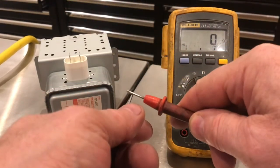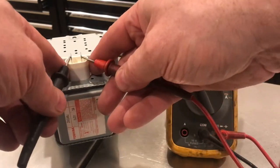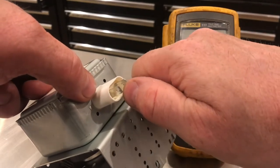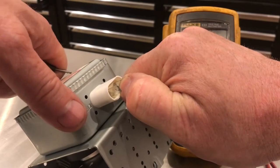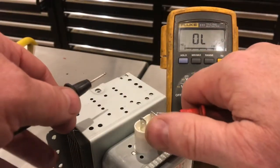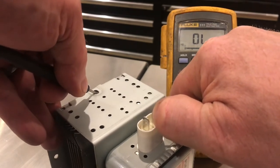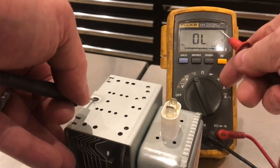When you touch the wires, you can hear continuity. Now there should be continuity between the two pins, but you should not have continuity between this and the case. You may have to push it on nice and steady and scratch, just in case there's a coating on it. There is no continuity through this — watch the meter, it won't move. We'll firmly press onto this pin and then to the case, and you see no movement at all, which is what a good magnetron would do. We'll do the other one, and you can see there is no movement on the meter at all.